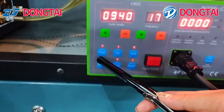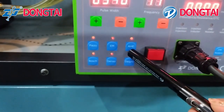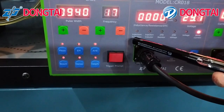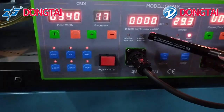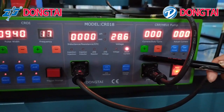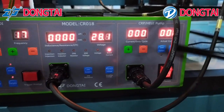You can drive the piezo injector with electromagnetic AHE function. These are the supported brands. We can test the inductance and the resistance for the injector. It can also drive ZME. Here we can adjust the current and the duty cycle.